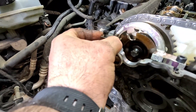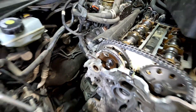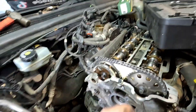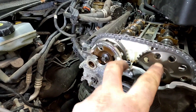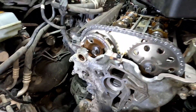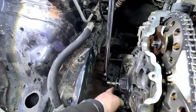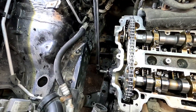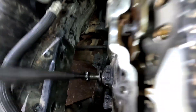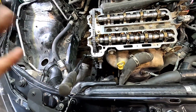It aligns in like so and we tighten the two allen keys up. Before we torque the camshaft pulleys up we need to pull that pin out of the tensioner - you should see the pulleys separate as the tension comes on, beautifully. Now we can torque them up. Once everything is torqued back up, put the crank drive pulley back on, jump on a bar and take the crankshaft 360 degrees to make sure all the marks line back up correctly and the engine isn't locking up - if it locks up you know something is wrong.